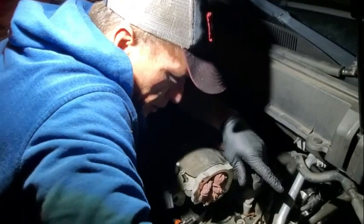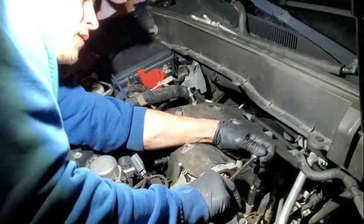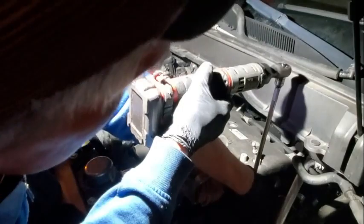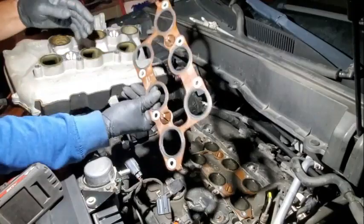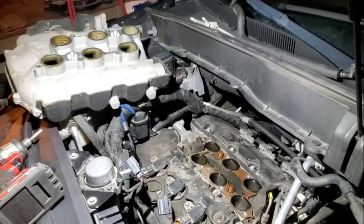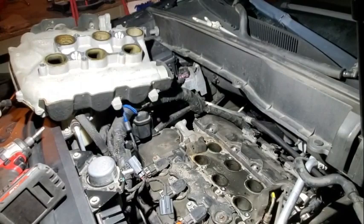And there's that last one — the 13mm. That is the sharp one. So this is the gasket — same gasket. On the newer ones they've got a lower gasket but also upper plenum rubber gaskets. This one's just older. Let's go ahead and take this gasket off for the intake — it can go in the garbage because we will be replacing it. Better safe than sorry.